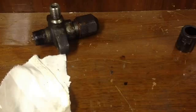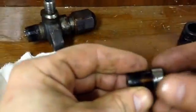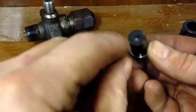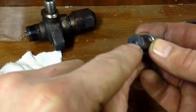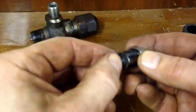Don't be afraid of having a go, because there isn't much that can go wrong. I got an engine the other day and thought the pintle had gone — there was no pintle visible. I tried the injectors, saw they were spraying not well but spraying, and threw it back in. What had actually happened was someone had stripped the injector and the little piece that pushes and holds the pintle down with the spring was gone, so the pintle was just free in there with nothing pushing on it at all — and it ran fine.